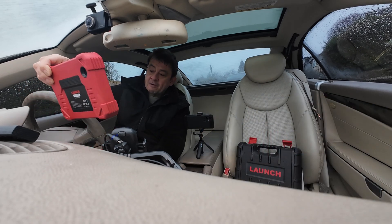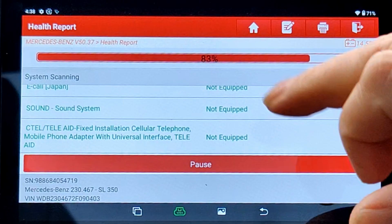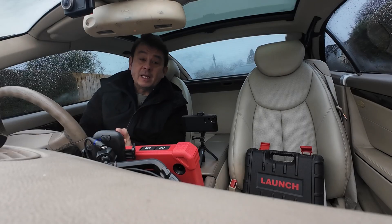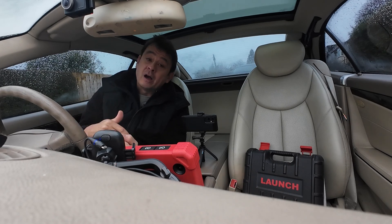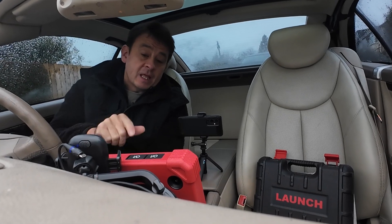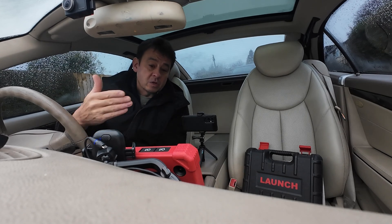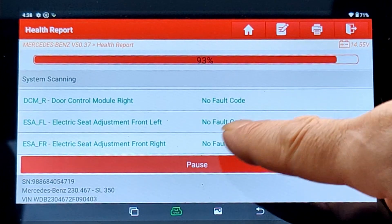You'll get lights and things that'll flash up on the dashboard as well - don't be too alarmed, that's normal. The ones in green are the ones that have passed, so there's no issues, or that it's not equipped on the vehicle, because at the moment it's running through every single module. Certain models of car are going to have more facilities than others. For example, if you haven't got heated seats, the heated seat control unit on your launch is still programmed into the software and it will go looking for it on your car. If it hasn't got it, it just moves on to the next - that's why you get the green sometimes.